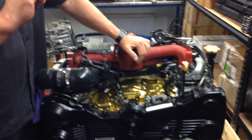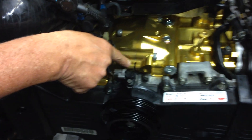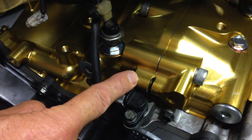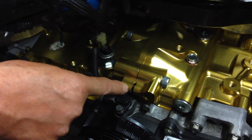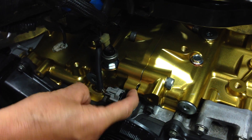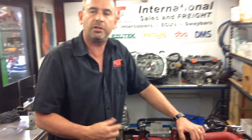One last small thing to note when you go for aftermarket billet block assemblies: before turning the engine over, you'll notice a little gap here — that is the joint between the right-hand and left-hand split halves of the crankcase assembly for the short block. When they manufactured this block, they left a nice little slot there to put a screwdriver in to pry the two halves apart when you want to dismantle the engine.